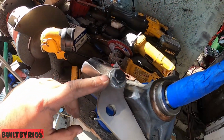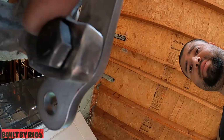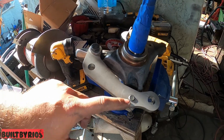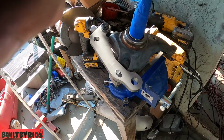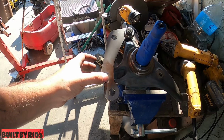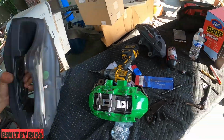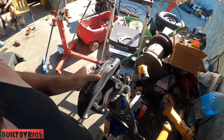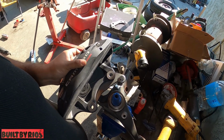All right, so we put a washer on this one. It's already Loctited. We are light-topping this one. Remember, it goes through the bottom. We're just gonna shave this so it can be as flat as the bracket. If not, that's gonna teeter-totter the caliper. So I'm gonna bring it back. All right, shave nice and flat. So now the caliper mounts like that. See? Again, a good video. It mounts like that, and that's the end of it.